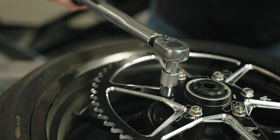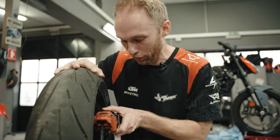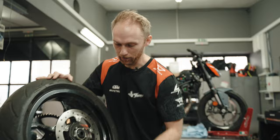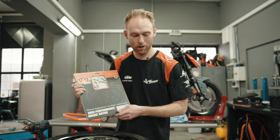Sprocket done. Now the brake. When we designed the double brake system, we faced an issue — when we wanted to mount the four-piston caliper we saw that it actually touches the wheel from the inside. The solution was to increase the size of the disc itself, and luckily we have a sponsor, Moto Master. So we went from 240 millimeters, which is the stock size, to 260 millimeters, and with that we don't have any more issues with the caliper touching the wheel.